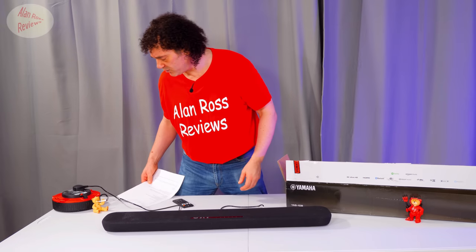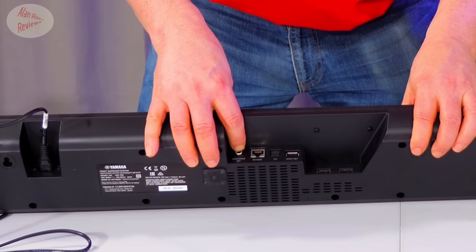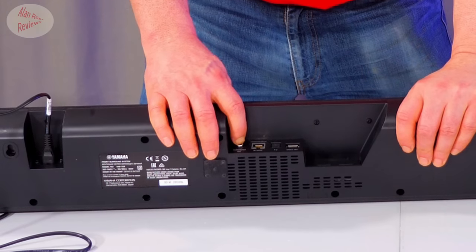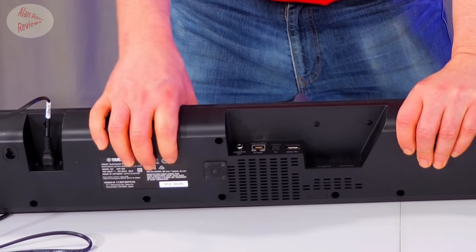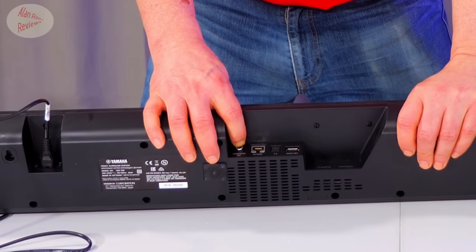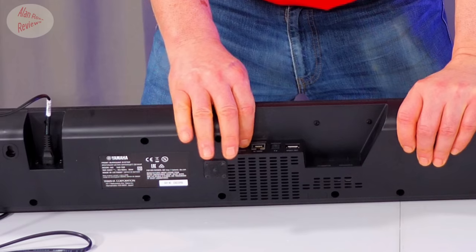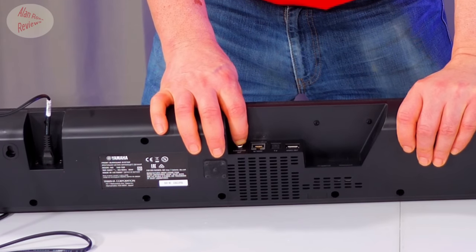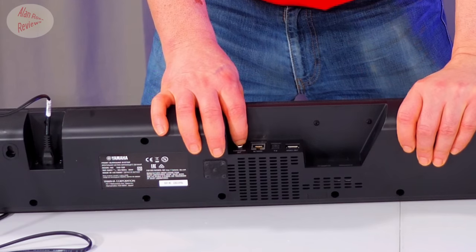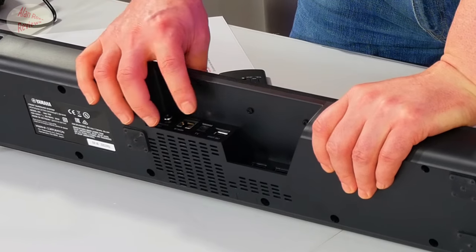Let me quickly show you the back. There you've got your power lead, your subwoofer out. I'm not quite sure what the crossover is on this — on the 107 there was a problem where the crossover was set to 160 Hz, which is very high, and the internal subwoofers kept going, giving you a doubling-up of bass. So when you add a separate subwoofer to upgrade the sound, you need to make sure you have a low-pass crossover filter — set it lower than normal, around 80 Hz or maybe even 60 Hz. You also want gain control on that subwoofer. There's your ethernet connection for hardwiring to the internet, and your optical in, labeled TV.